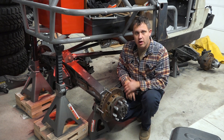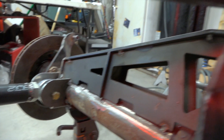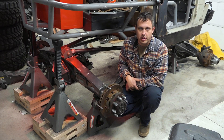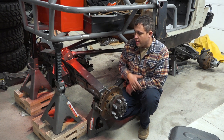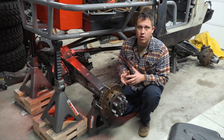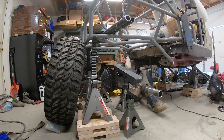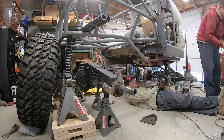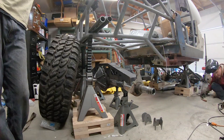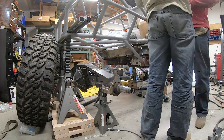This week we got with Barnes 4WD. We have the Barnes 4WD rear truss on, we got the pinion bridge on, and we wanted to build a four link on the back end of our buggy. I tossed around whether I wanted to just do upper triangulation or a double triangulated setup. We decided to go with an upper triangulated setup and triangulate the lowers as much as we can, but we didn't want to build a crossmember and bring the lowers all the way in — it would have gotten in the way of the drive shaft and a few other things.